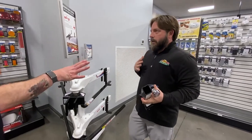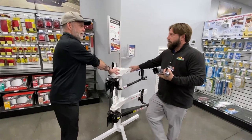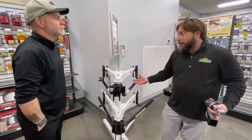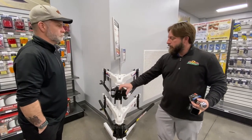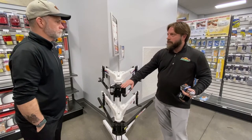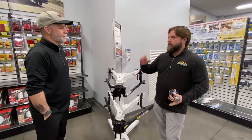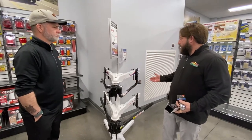If you buy your camper from Walnut Ridge today and get the E2 as part of your package deal, these components are already going to come with that. You don't see the shank here because there are different shanks for different heights — newer trucks sit higher, so it takes a different size shank. When you get a hitch from us with your deal, everything you need to tow properly for your trailer weight and what your truck can handle will be set up. Newer trucks also have a 2.5-inch receiver, and we even carry the sleeve to reduce it down.